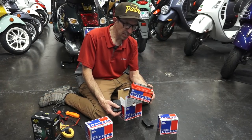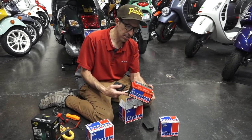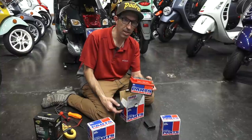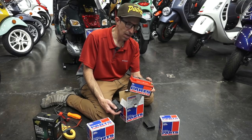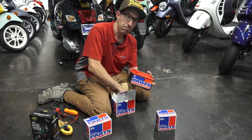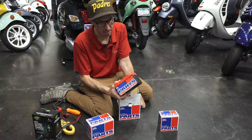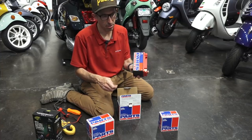Some of the advantages of these lithium ion replacement batteries: when properly maintained and not allowed to drain all the way down, with a good charging system, they can deliver 2000-plus cranking cycles. A standard lead acid battery usually delivers about 350 cycles, and a nicer AGM or sealed YTX12BS can typically get 500 to 1000 cycles. So these potentially can outlast the standard lead acid battery by double, which adds extra value.